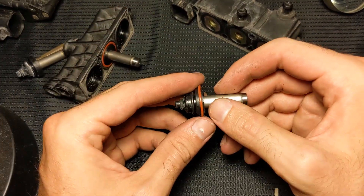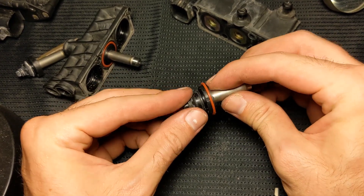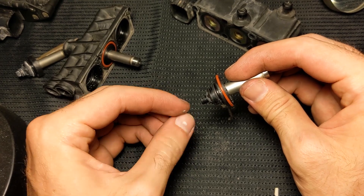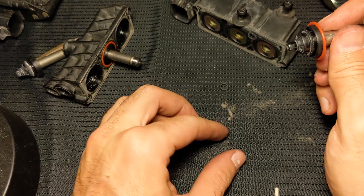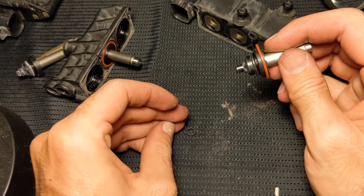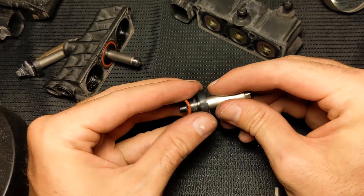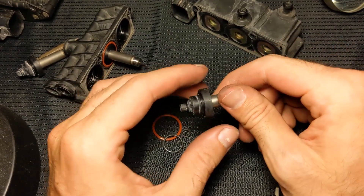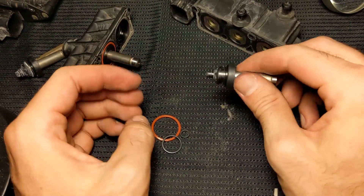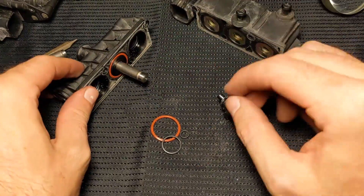What's stuck about the solenoid is more internal. There are these o-rings that are clearly dirty from desiccant material. To refurbish this on your own, you can just clean these off — I would use some silicone lubricant or a spray and just spray them down, making sure they're clean from the desiccant material. Make sure to keep these o-rings somewhere so you don't lose them.